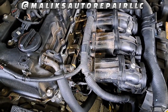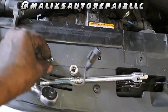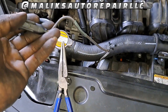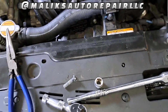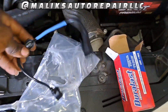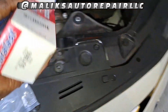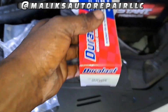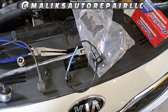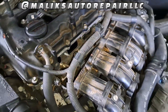I broke the bolt free with a 12 millimeter socket and a ratchet — may need a little leverage because it's going to be tight. And now you gotta make sure you remove it from that bracket — it's like a little tab. I used some needle nose pliers, bit it forward and just pressed it and it will pop off. That's how we're gonna get that guy out. Now we're going back in — gotta go get the part. Brand new part: part number SU13905 — I got it from AutoZone. I like to use the dealership item, OEM parts, but it's Sunday and I can't get to a dealership, so this is what we're working with. We're gonna go ahead and install it in reverse order.